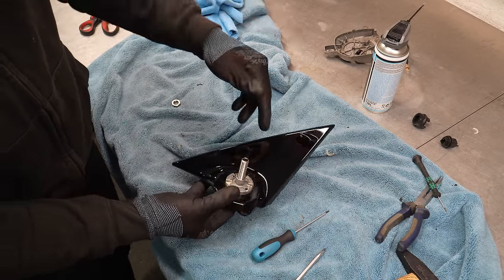So he's pushing the dent out from the inside. When the dent is this sharp, you can't do it with just glue and pulling. You have to press the metal from the back. And just like that, the dent is gone. What you see now is just a scratched surface where the paint is missing. But as far as the dent goes, it is completely gone. This can be further improved with wet sanding and polishing. But this car is gonna go to Xenon for a complete detail eventually, so I'm gonna let Eve do that. I think he can make this scratch almost completely disappear, but I think at least 80% better than what it is right now.